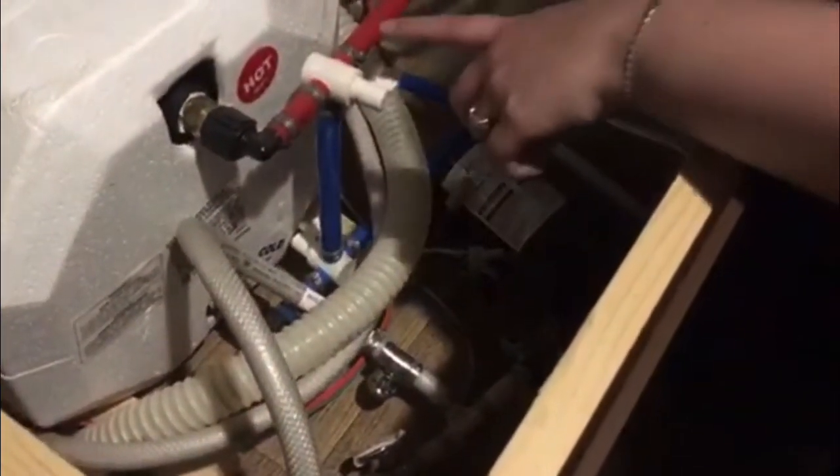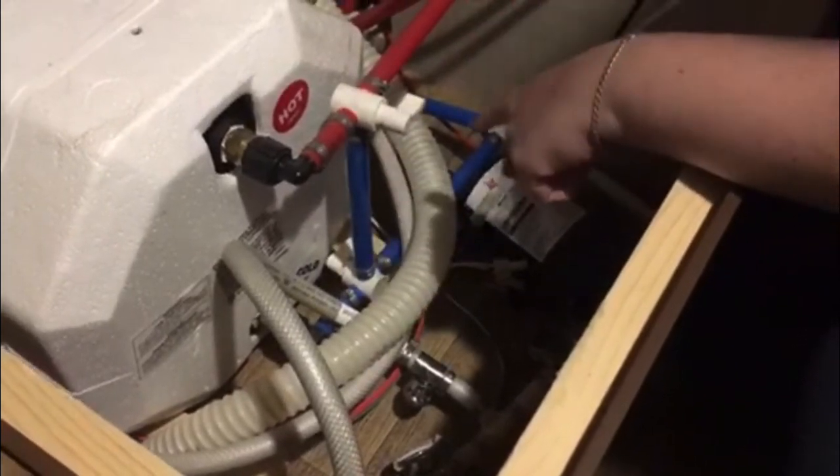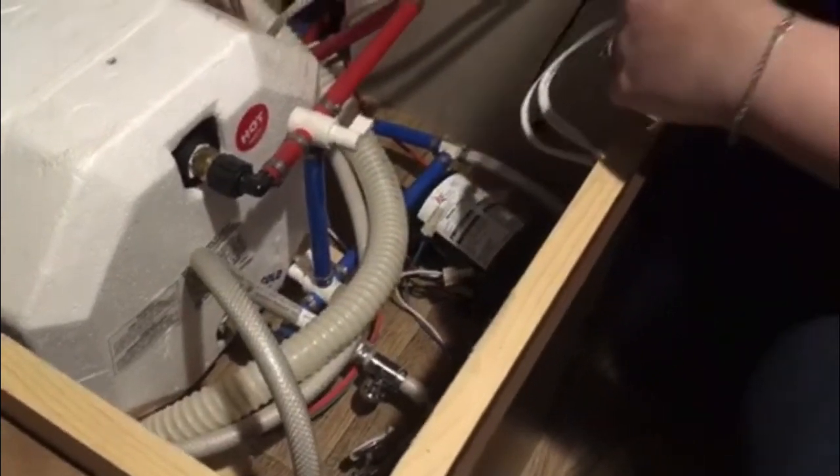In the back here you've got the bed that lifts up — the clasps just go right into the corner there, giving you more space for your dinette. Pulling these cushions out, underneath the dinette seat you've got the interior access to your hot water tank. The biggest thing to note here is you've got both of your valves — these are most important when winterizing. You're going to close both of these valves and then do your winterizing process. The reverse goes for when you de-winterize in the springtime.